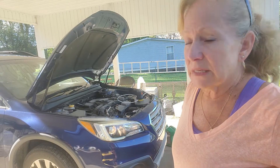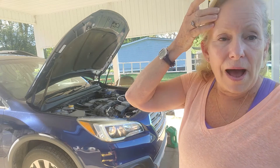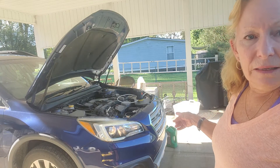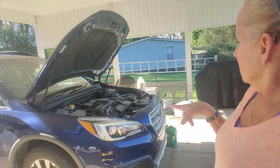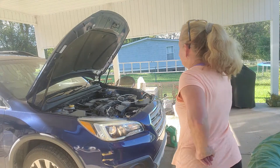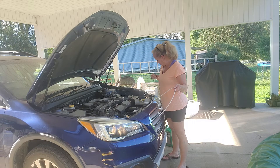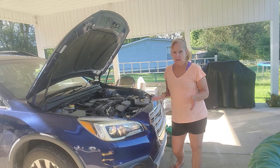I am currently starting the car because this works a lot better if your oil is warm — you don't want it to be hot. I know it will warm up a little bit. You can see I've got the extractor sitting over there. I'm going to hook it up to the battery. And the dipstick tube was the word that I could not remember. I just want to get the oil motivating.